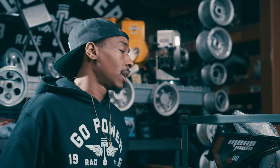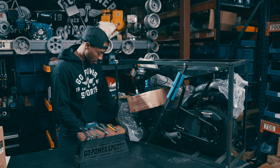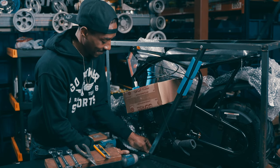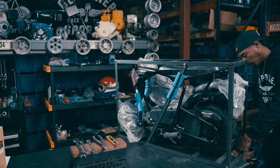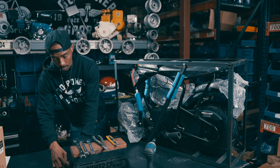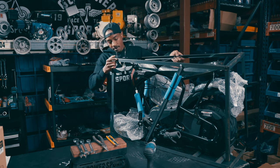So to get started, we're going to get our Mega Moto EZ80 out of the protective shipping frame. If you look down at the bottom, get started with the 14-millimeter bolts — they'll be tight enough to hold it together but you should be able to just take the bolt off. There's going to be a bolt at each corner and one in the center, giving you a total of five bolts. Once you get all the bolts out, you'll be able to remove the top of the carrying frame.